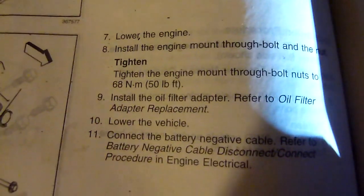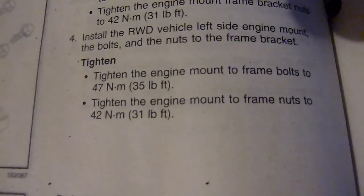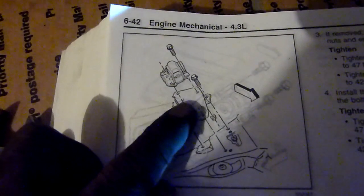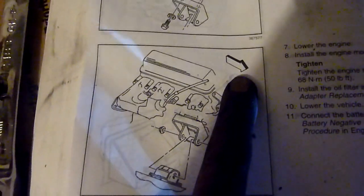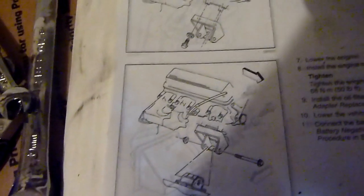Going back to the book, you can see it's 50 for that bolt, and for the other ones you tighten to 31 or 35 — I went ahead and made it 35. So for these three mounting bolts I tightened them to 35 foot-pounds. I did not remove this one because I did not want to deal with getting the nuts loosened. This main bolt is 50 foot-pounds — keeping in mind the front of the engine is there, so it goes in from the front towards the back and that nut is tightened to 50 foot-pounds.